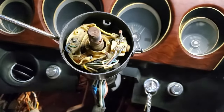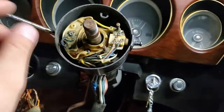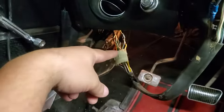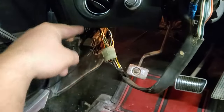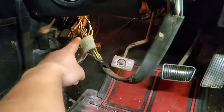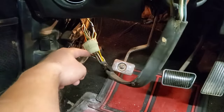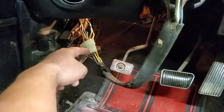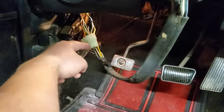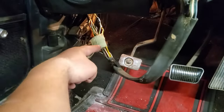I'm going to give you a couple of tips on possible problem locations if you're having issues with your turn signals. One typical location would be that plug right there. You have a male end — this one here is your male end — and then you have your female end on this side, which has all the little holes where the male ends go in. These little holes sometimes open up over time and do not make a good contact connection.